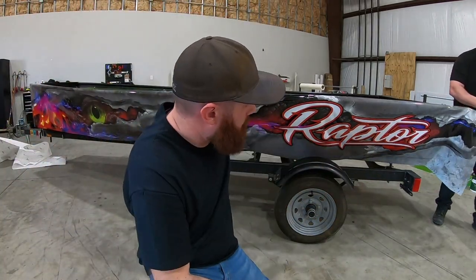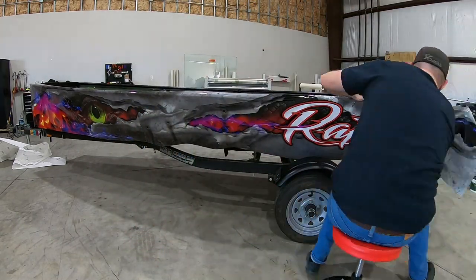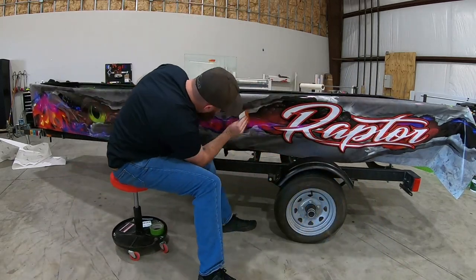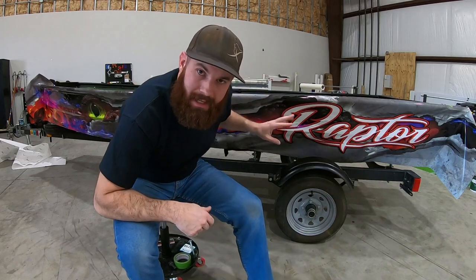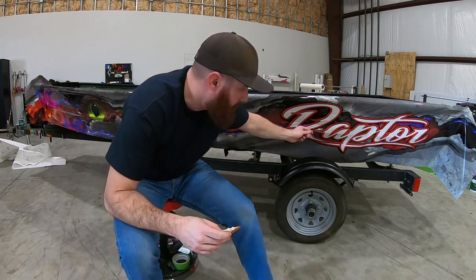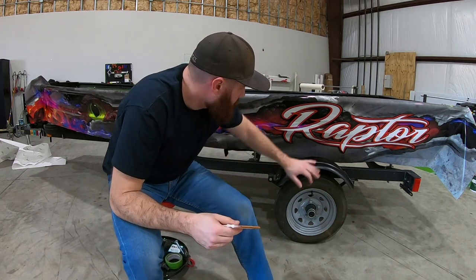Got the backer off — the wrap is just kind of floating on there. Just going to squeegee it down with the little felt-sided bumper card and keep trucking. Got that top edge kind of tacked down with the bumper side of my card. This one has a lot of little rivets and little screw indentions, so just be mindful when you're going over that stuff. You just kind of want to glide over them — you don't want to press them in just yet because that's what we're going to use the heat for. Be careful so you don't rip through your wrap.